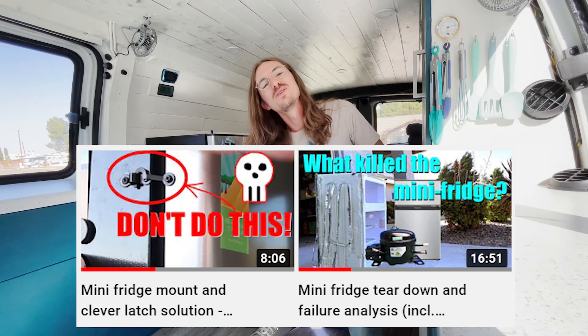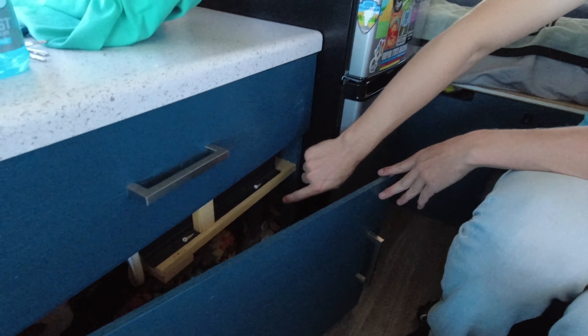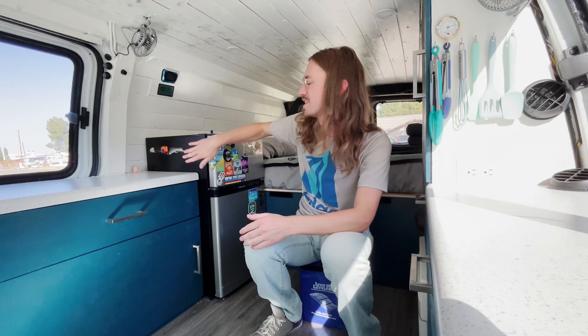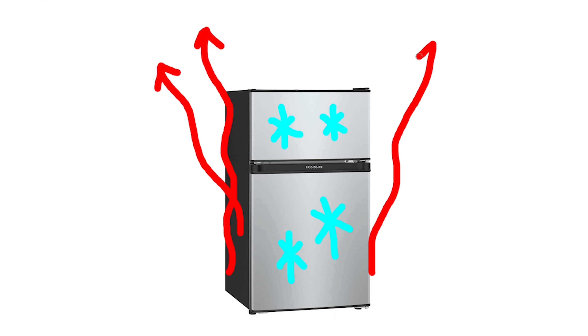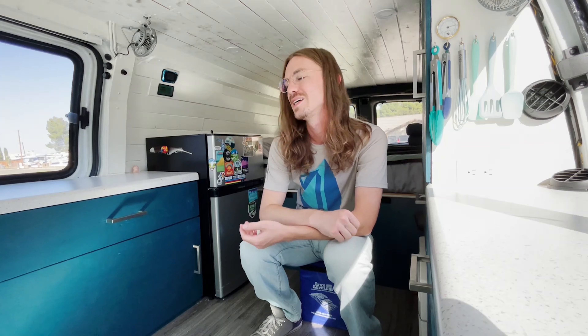250,000 watt-hours through the unit. It's worked flawlessly, but there was a casualty — I killed my fridge. Again. This time I didn't drill any holes through any condenser lines and leak out all my refrigerant. This time, all that extra air getting pushed through the cabinet and onto the fridge itself was just too much heat. Compressor couldn't take it — compressor no longer turns on. The fridge dissipates its heat through the sides, and yes, I knew that when I was doing my very rushed van build. My original fridge lasted almost two years without any problems, and the only thing that killed it was when I punctured the cooling line itself.